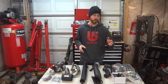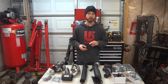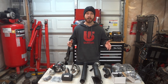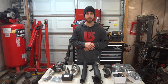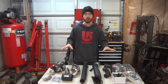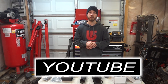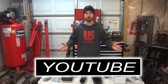Last but not least on the table, we have one of their diverter valves — and obviously we have two of these for the 2.7. They come with three springs, the highest rated at 30 psi, which is going to be perfect for our application. If these can hold 30 psi and perform, this is a great budget option for an upgraded diverter valve. Everything on this table is available on the JAE website, and for the week after this video releases, you can use promo code YOUTUBE to save 5% on your order.